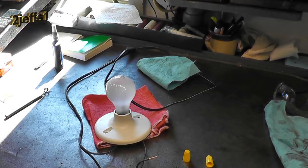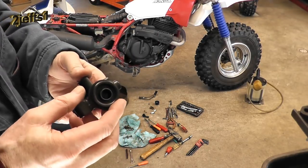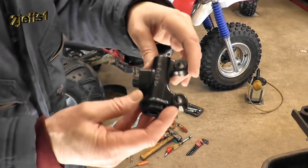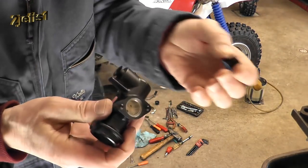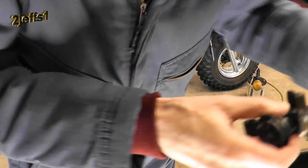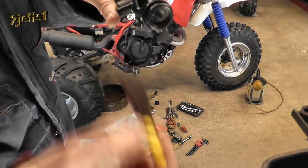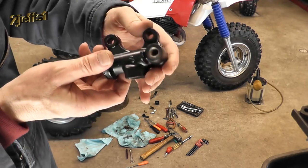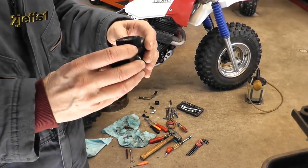Bang, now I can go home. No, let's show you some more stuff. Now here's what I'm going to be doing for the rest of the day. For you folks that might be curious, this is the master cylinder for the rear brakes, which is no longer available for that machine. So I have sandblasted it — and you always plug off all the passages. I'll show you what I've got here. The bore was a little bit skunky, so what I did was I made up a red scuffy pad, chuck them in a drill with a reamer, and this is what you end up with. Everything else got cleaned up best as I can, and we're gonna reuse this.